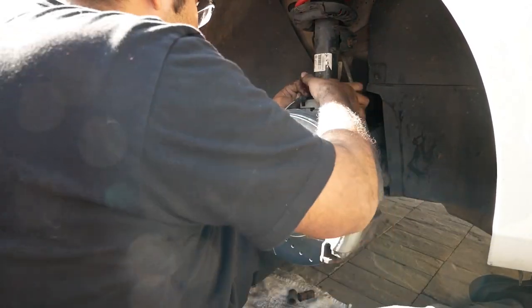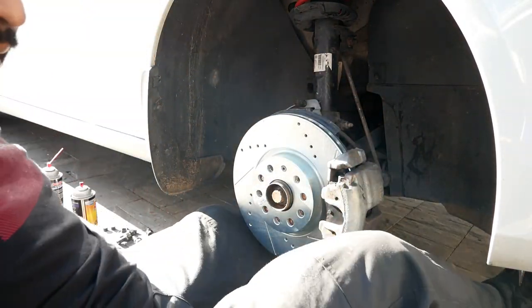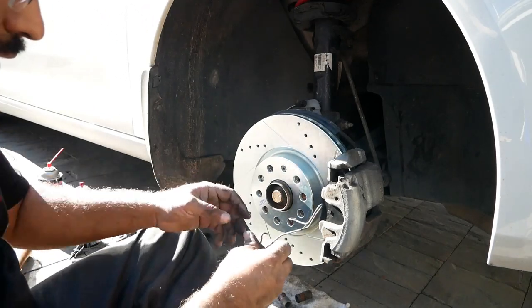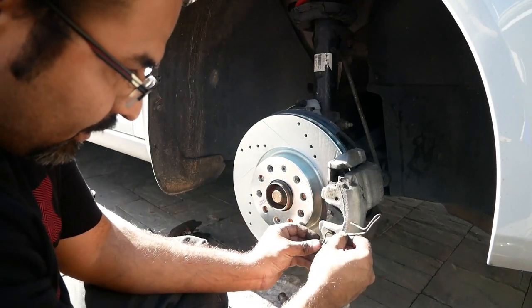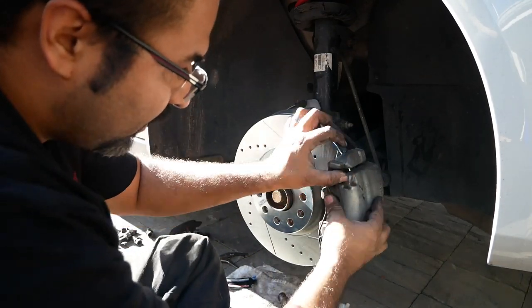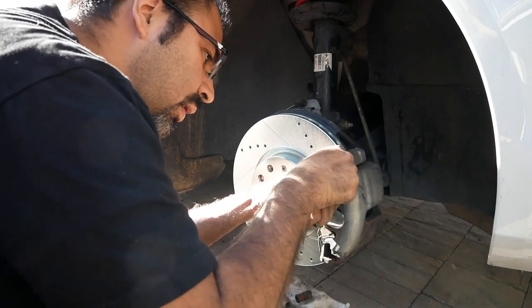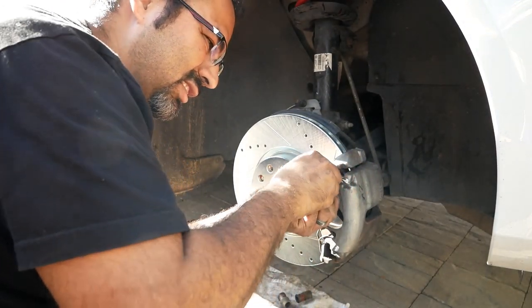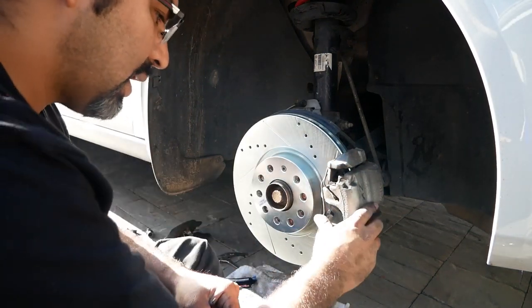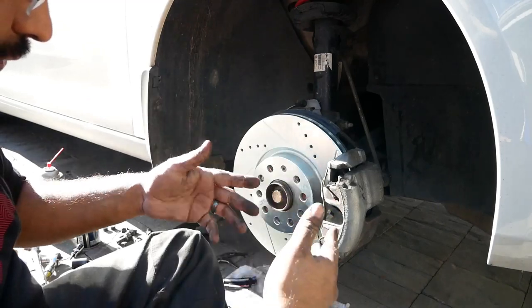Secure your ABS sensor wire right here. The last thing is your spring clip — this is the one you're going to hate the most out of this whole job. You put it in here and then bend it with your finger, then tap that sucker in with your hammer. And that should be pretty much your front brake job.